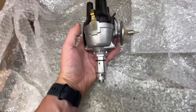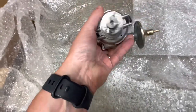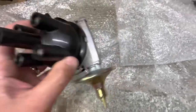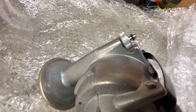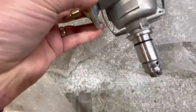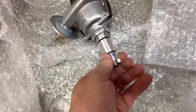On first look, it looks basically the same as the distributor that I have in there. This is a 25D distributor — I think it's stamped on there somewhere. It looks a lot like the original, but it's not quite the same. It's missing the little spring-loaded piece underneath the advance wheel. But the diaphragm design looks to be the same, and it came with an O-ring, which I wasn't sure if it would.